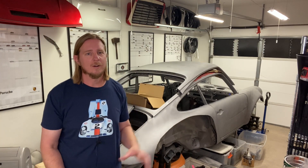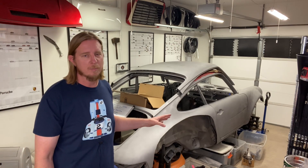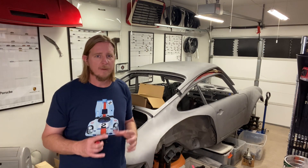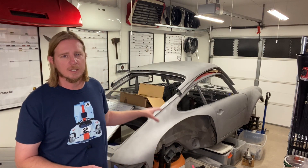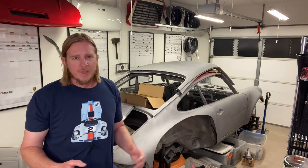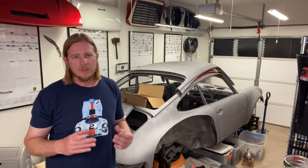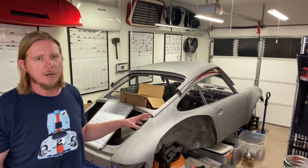That is one of the downfalls of sandblasting a car. Now the bright side of removing all that Guards Red is — look at this beautiful clean slate. You know exactly what's going on with the metal, no surprises underneath paint. I'm doing a variety of mods where I need to weld on extra brackets. This car will have RSR-style suspension with coilovers, like the '74 RSR, so I need to weld on several reinforcements in the back and front chassis areas. Here in Nevada — the Mojave Desert — it's one of the driest places on earth. The car's been in bare metal for four or five months and there's zero rust, so I'm not too worried about leaving it in bare metal here.